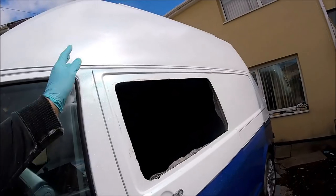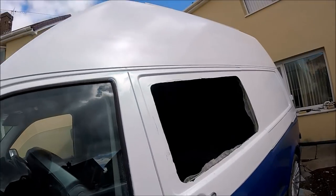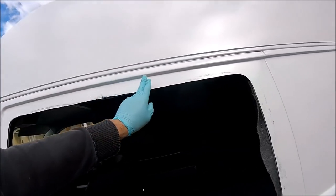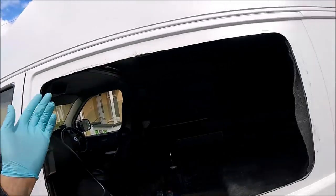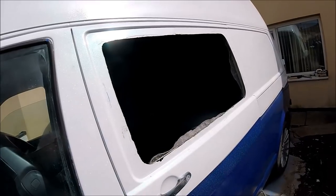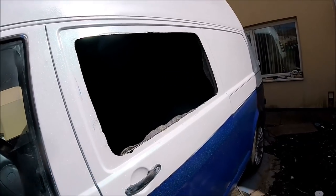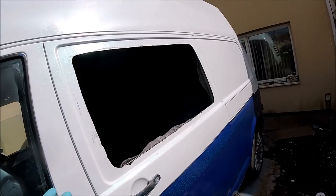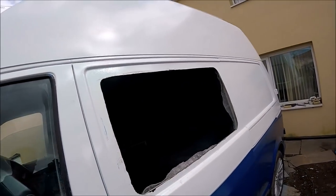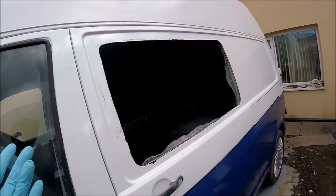So there's the hole all cut with all of the bare exposed metalwork. I've given it a quick sand back and a run round with the primer that comes with the fitting kit. Now it's just a case of giving a good wipe around the outside of the frame and then rolling more primer on here and also on the actual glass itself. First though I do have a bit of trim I got from a local automotive supplier - it's not a specific window trim but it looked very similar, so I'm going to fit that on and see what it looks like. If it's no good I can always fit the proper one later, but I'll run that all the way around and if I like the look I'll crack on with the rest of the primer, the bonder, and get the window on.